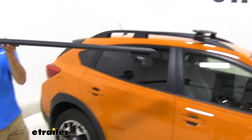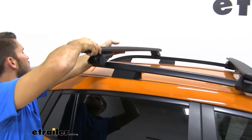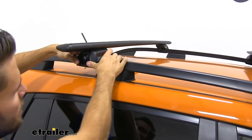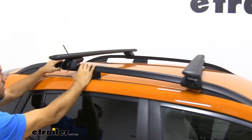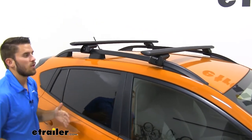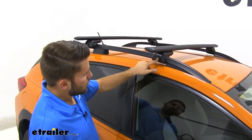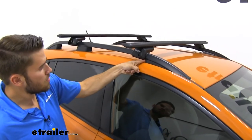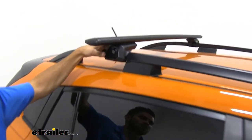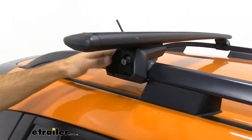Now we'll just raise it up and get it on our side rails. There's no set measurement that you need, you just want to make sure it's at least 27 inches. A nice little handy trick — just use points that are on your raised side rails. The front bar we have each foot making contact with this point right here. On the back side we've already measured to confirm it's at least 27 inches, so we're just going to have it touch this part right here and make sure we get that on both sides.